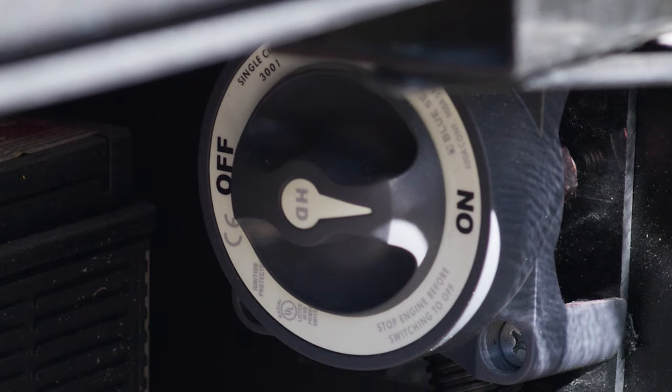Right here we have a vent for your air conditioning. We have a toggle switch for the dock lights — those are out back next to the backup camera. We have an auxiliary start button: in the event your chassis battery is not firing up your motorhome, you hold this auxiliary start button in, turn the key, and it will draw battery power from your house batteries to start your motorhome. It also works the other way too. We have mirror heat — on those days where it gets frosty outside, just turn on the mirror heat and it will melt away for a nice clear vision behind you.